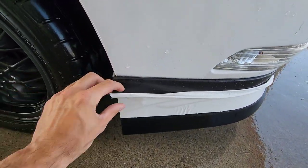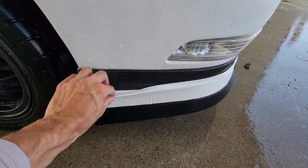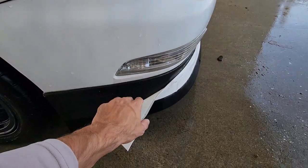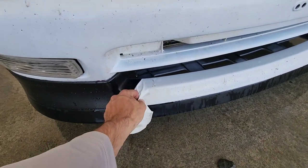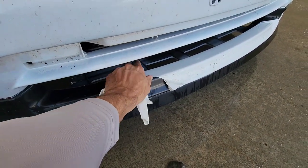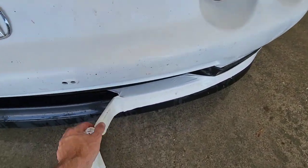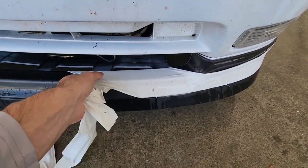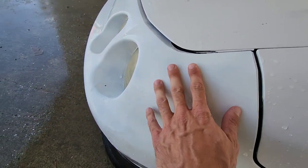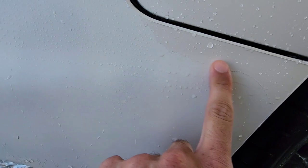Just a disclaimer - I've never had Plasti Dip do this before. I made the mistake of ceramic coating the lip before applying it and it just wouldn't stick. New Finish ceramic coating is very intense and works very well - I've never had that problem with Plasti Dip. I planned on taking it off anyway, so that's why I went really hard with the pressure washer. I've done whole cars before and pressure washed the entire car really hard and it never peeled off - this is literally just because of the ceramic coating underneath.